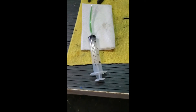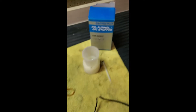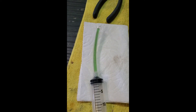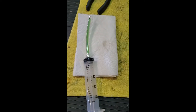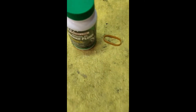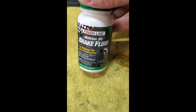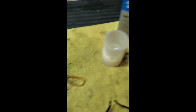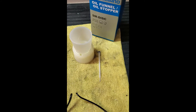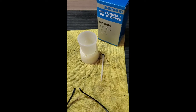Here's a list of everything you'll need. This is just a real basic syringe. The Shimano oil funnel stopper kit — we'll get into that in a sec, but that little tube came with it. I just put the tube on a basic syringe. You can see some fluid already in there. You need a 2.5mm and a 3mm hex wrench, and safety glasses. This is the brake fluid I'm using — Finish Line mineral oil. Shimano uses mineral oil, not DOT fluid like SRAM brakes do. These oil funnel and oil stopper are kind of key — if you have Shimano brakes and don't have this, spend a few bucks and get it because it's really helpful.